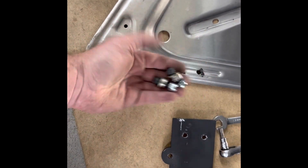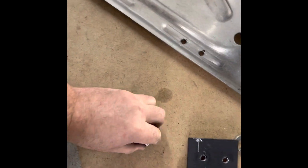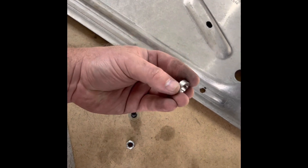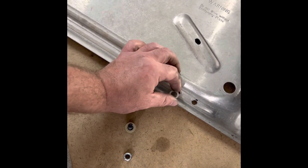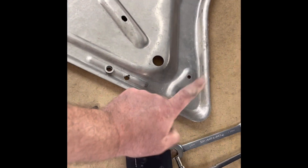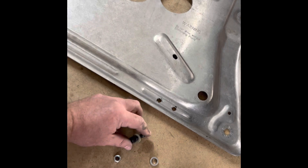Those two final bolts come with curved washers. The curve goes over that section on the outside — it's actually going to bite into it and help the bolt stay in place, so even with temperature change and vibration it should not come off. Every oil change I recommend eyeballing it and making sure everything is still tight. By the way, these bolts are 16mm — they're supposed to be one-time use but I use them often with no issue. You can also use blue Loctite on these for reinstall.